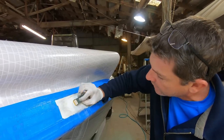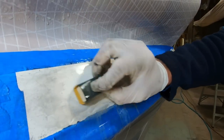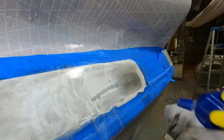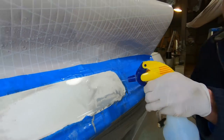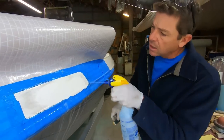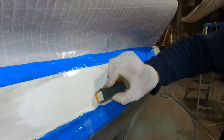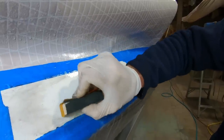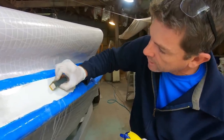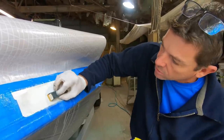I did a diagonal crosshatch and then I usually like to finish with what I call an orbital motion back and forth. For some folks with power tools — honestly I think finesse with little blocks is going to be the way to go on these smaller repair jobs. You do not need to put a dual-action sander or some big heavy-duty machine on there. Now I'm kind of going between the two damaged areas while still holding that circular pattern. For some folks that may be as far as you go.